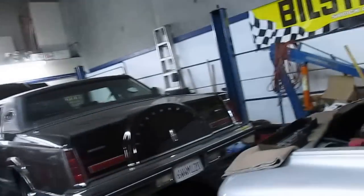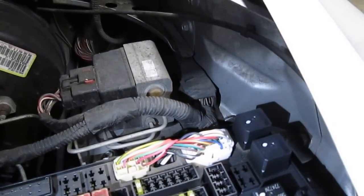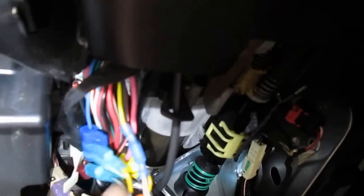If I go to the pink wire with the black tracer, that's where this alarm circuit is hooked into the ignition. I pull that out and disconnect the alarm from that part of the car's regularly functioning system, because it's spliced in there. When I come back out here, there's no noise — the relay is quiet. I've done this several times now. What I found out is it goes for about a minute to a minute and a half, just clicking, and then it finally shuts off. An alarm is not supposed to do anything like that whatsoever, and as you can see they've got all kinds of stuff hooked inside here, taped up, with stuff hanging everywhere underneath.